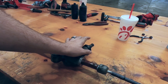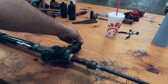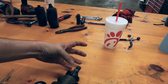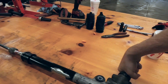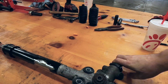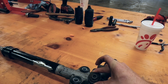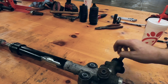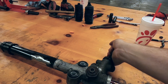This is pretty much ready to go in. The only piece I haven't ordered yet is the collar for this - you need the NB spline adapter. We were trying to take it off at the junkyard but we couldn't get it off, so we'll probably grab that OEM part from Alex Todd. Assembly goes together and at this point I can twist it with my hands, which is a big plus from where it was 20 minutes ago. I ended up having to loosen this - I stuck it in the vise the other way, grabbed onto these sides with a pair of channel locks, loosened this a little bit, put a 17 on here, backed it off like two turns and tightened it all back up. There's no slop in here but it's turnable by hand. Originally I had to grab it with vise grips and spin it, which isn't the goal.